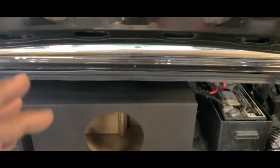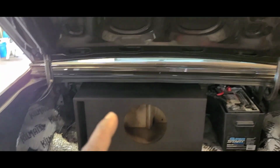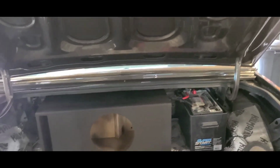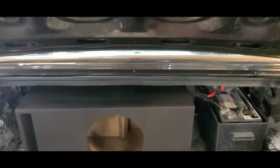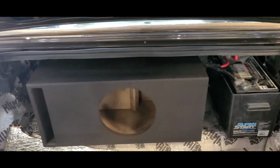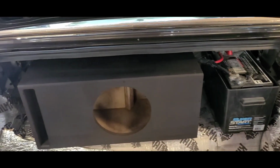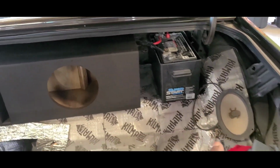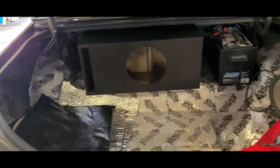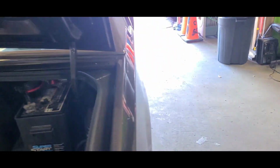So speaker coming. The RMS rating on that speaker is the type of amp that I'm getting. A little more wattage than what's necessary to run this woofer that's going to be here. It's going to be the right one with the right power, exactly what I need with a little bit more. All right, my 4-channel amp, or might even go with a 5-channel amp, because I'm going to be running those 4x10s.